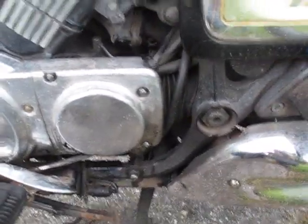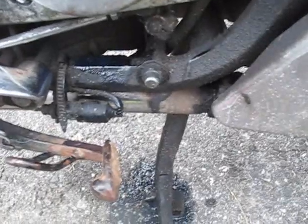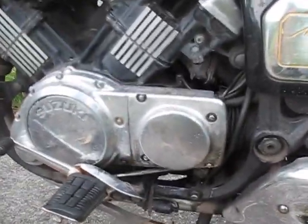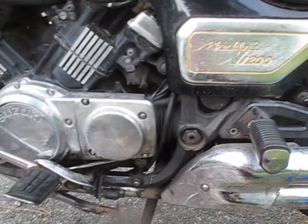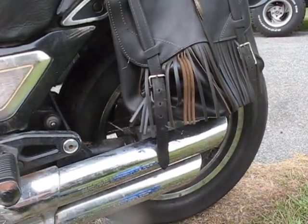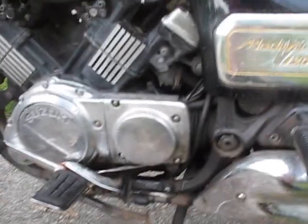Patch it up and you're all set. Remember, if you're like me you probably dribbled a little onto your exhaust pipe, so if you see a little smoke next time you start your bike, don't be concerned. Also, don't forget to do your final drive — I just did mine. I change the oil in the secondary unit and the final drive every two engine oil changes, so about every 6,000 miles. Your intervals may be different, and if you want to change it more often because your bike is older, go for it. This is really important stuff if you want to keep your driveshaft bike running well into antiquity.